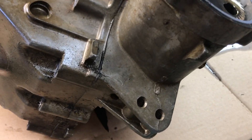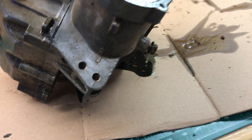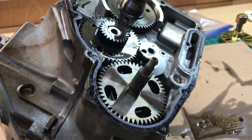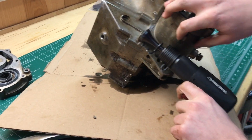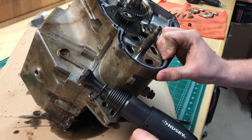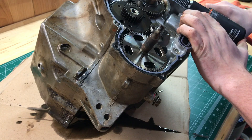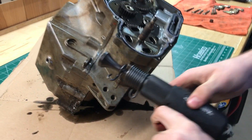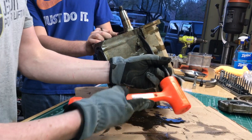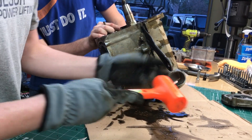This is really stuck together. What we're assuming is these are hammer points — spread points to try to distribute the load and press them apart. The best way to do it is with a little friend, the air hammer. The hard part is the glue — you've got to break the seal on it, because every time you hammer it apart it wants to come back together. Once you get it separated a little bit you can shove something in here, and now we're just trying to pry it apart and get it to separate completely.